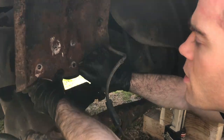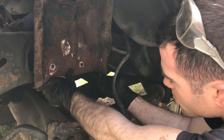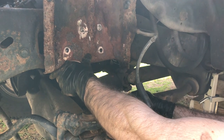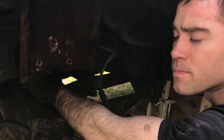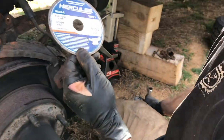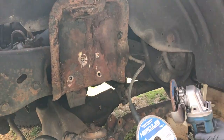That really made quick work of all the rivets. The last one was down here — probably the most difficult because there isn't much access — so I just took the sledgehammer and smashed it and popped it off. I'd suggest doing it that way. To clarify for everyone: an O45 wheel is a thin cut-off wheel, and a grinding wheel is the thick one. Those are your two choices of disc to attack this.